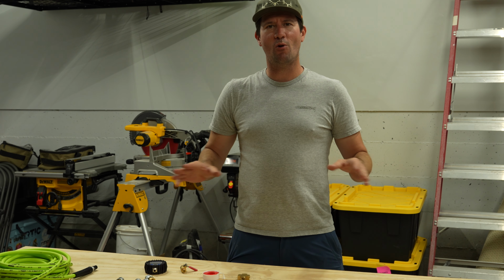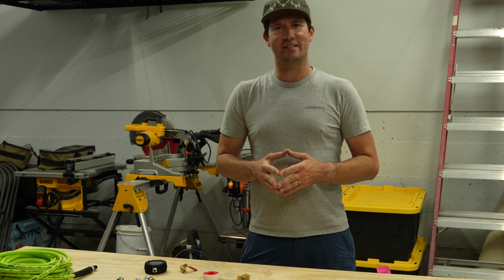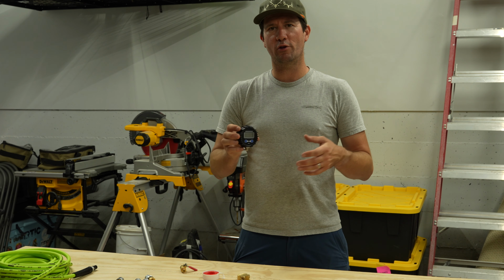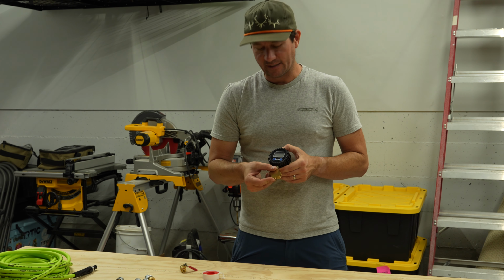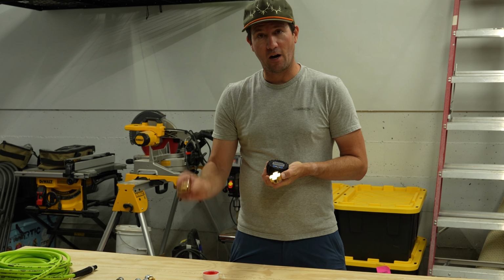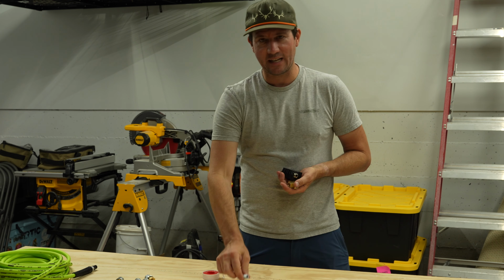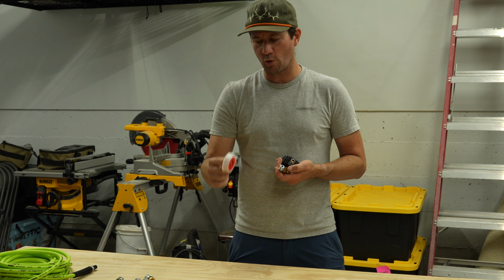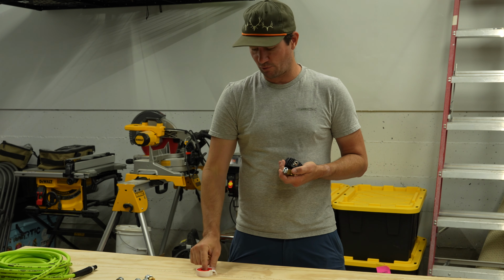Okay, so now we know all of the parts that we need to build our system. We're going to start out with the easiest step first, and that revolves around our air pressure gauge. I'll walk you through this in close up so you can see it. Our air pressure gauge is going to thread into our four-way brass fitting. We have our on-off valve that will go below it, and then we have an M-style plug that goes at the bottom of the on-off valve. And of course, we're going to use good old pipe thread tape as well. So let me show you those steps really quick.